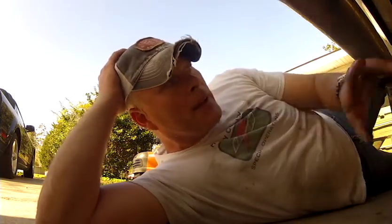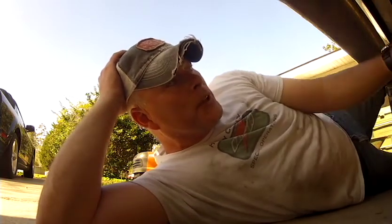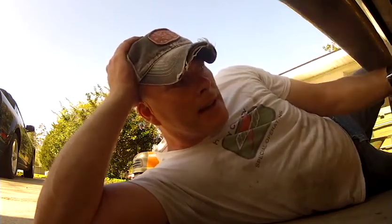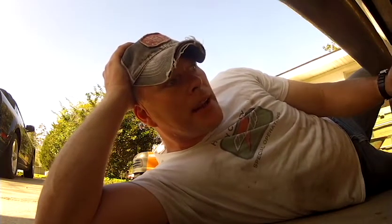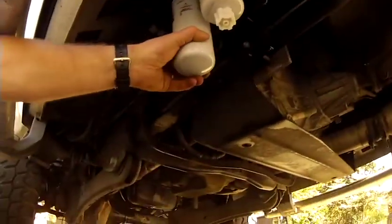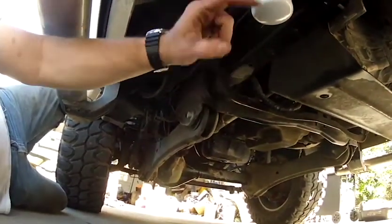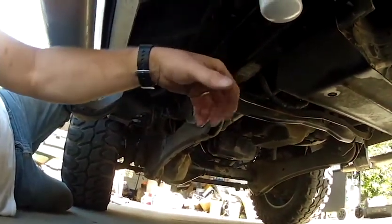I'm looking online, and there are adapters, and people are talking about hundreds of dollars for these Ford adapters. But I wanted to see what was going on. I had a little bit of off-road diesel for my backhoe, and I had that top fuel filter off. I poured it down into the housing for the fuel filter, and I came down here to the Airdog and loosened up the fuel filter, and some of the red, because off-road diesel's tinted red, ran back around here.